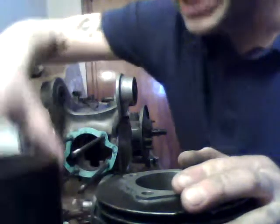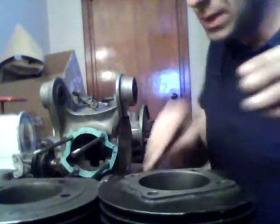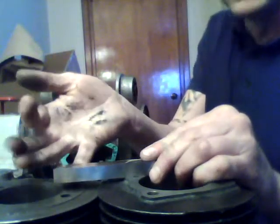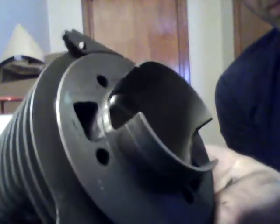Now, the other option you have is you can actually shorten the barrel itself. These are both Series 3 barrels, but you can see this one here is shorter by about seven millimeters — I've done this on my lathe. This one here is stock; this one has been machined. Some people do the machining slightly different than this. This is actually one of the first ones I did — it's not even fit to be used yet. It needs a rebore before it can be used.